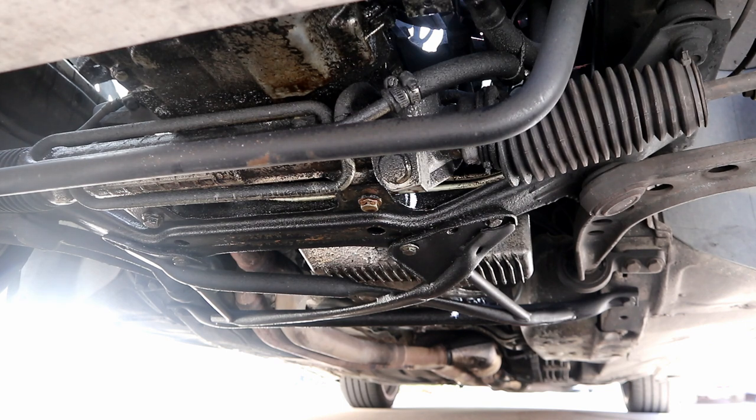It's a lot of oil, and I would not run that much oil without an oil cooler or a modified oiling system like that. Because there's 2 quarts of oil in the oil cooler and the lines, it can run that much oil. Of course, you have to prime the cooler, so when I do an oil change, I'm not putting 9.5 quarts in immediately. I'm putting 7 in, then I'll prime the cooler, then top it off with the extra 2 and get the oil level dialed in, and then I'll add another quart on top of that. E36s love to run a quart high, especially the six-cylinder cars. So being a quarter of a quart low out of a 9.5 quart system isn't really that bad.